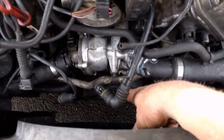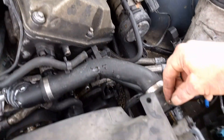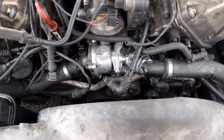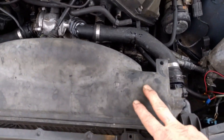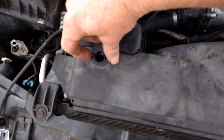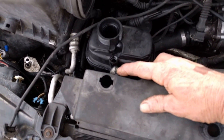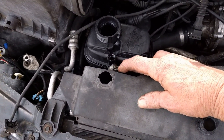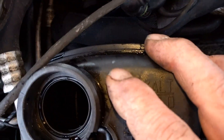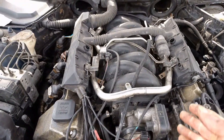Take your fan off — blade and clutch — take your hoses off. These are just pull clips if you've never done it before. Take your alternator hose loose and all your hoses off. We're going to take the fan shroud out — that's basically just to give you more room. When you take your fan shroud off, you have to pop this little thing off. If it's still factory it has a squeeze clamp; just get it off and put a hose clamp back when reassembling. There's also a hose and a plug down on your fan shroud.